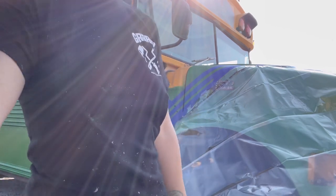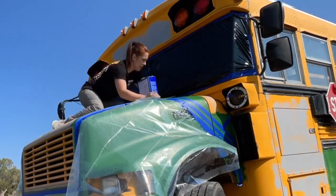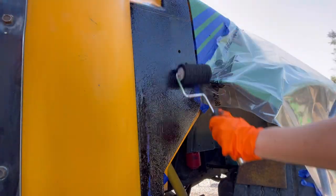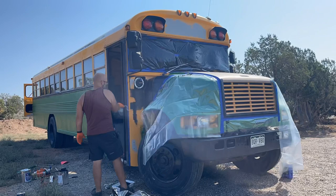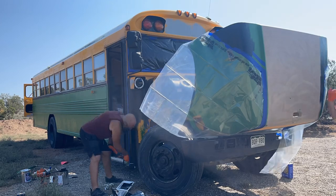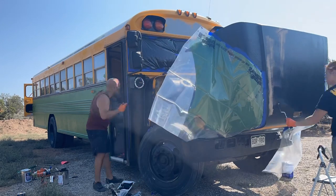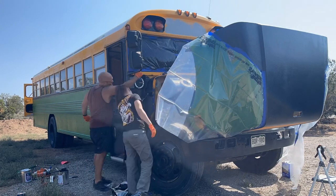We also taped off all of our rubber gaskets on the bus — we couldn't remove these, so we taped them. Since this is a textured surface, there's always a chance of bleed-through on your tape, but you can minimize that by not applying too much pressure when putting on your second color. We also re-prepped all the green where we were applying the black — re-scuffed it and hit it with an extra layer of MEK to make sure the black would adhere properly. It's important that you always re-scuff and re-MEK any liner that sat for longer than about 12 hours.